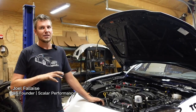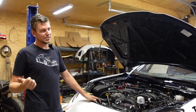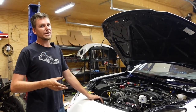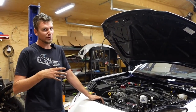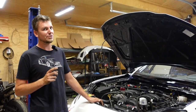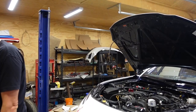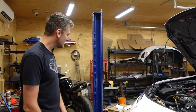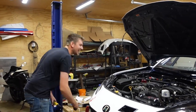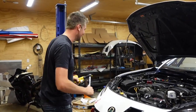I'm going to start at the top in the engine bay and show you what we do to remove the transmission. Step one: always disconnect the battery. Because the starter is related to this transmission, we have to pull it off — rather than do some 12-volt welding, which would make great outtakes. The 10 mil is missing. It's always missing. I found it. Everybody knows the 10 mil is always missing.